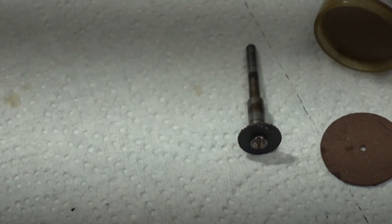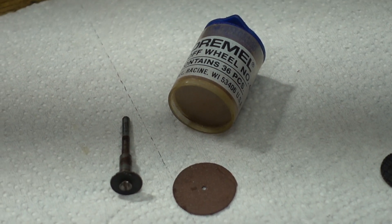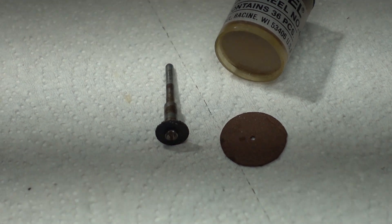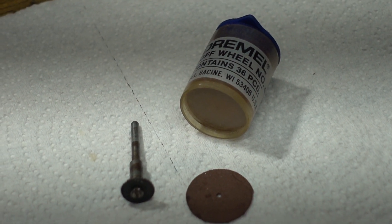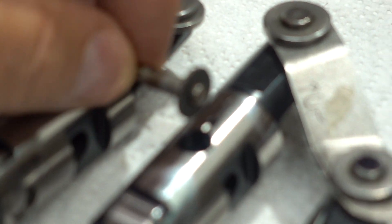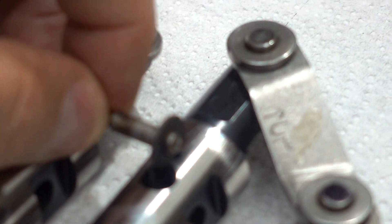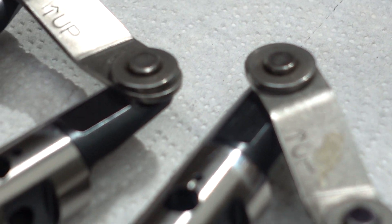If you're going to do it by hand, I would suggest using the red Dremel abrasive wheels. Wait until it's worn down about half the size so the wheel is pretty small, and then even sharpen the edge of it a little bit on a stone so you've got a sharp edge. When you lay your Dremel in, you're laying it in and it's not getting up beyond the hole — you're just cutting that little notch from the feed hole down to the gallery hole.